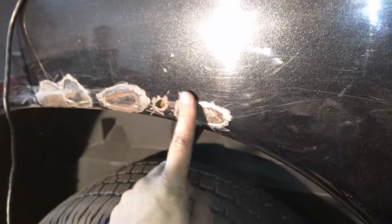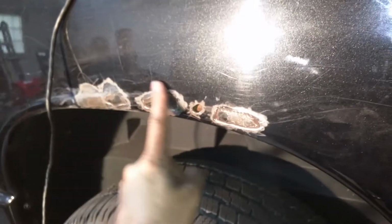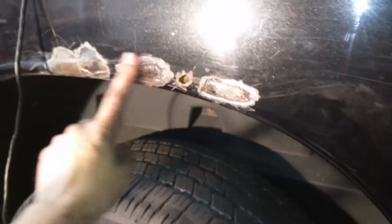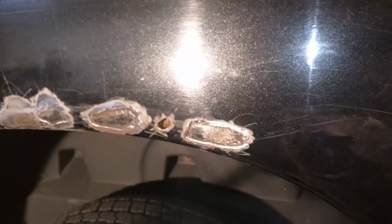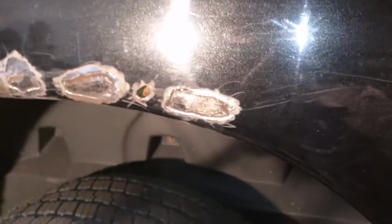So what I'm going to do is spray, using a tube, a lot of rust converter inside the wheel well here, which hopefully will keep it from rusting in the future. And I'm going to come back to this tomorrow because my neck is absolutely screaming. I can barely sit. So in the next video, I'm going to go ahead and do that rust prevention that I'm telling you about so that it'll be ready for prep and some filling in of the quite substantial divots I'm making. I have 3 more to make, and then I can get in there and really clean it out.